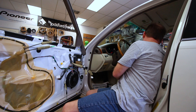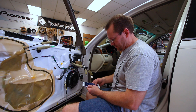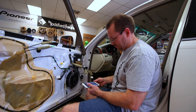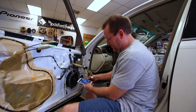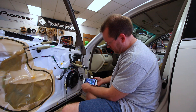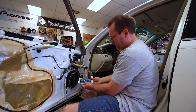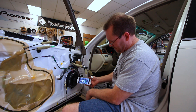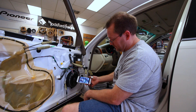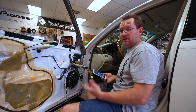Now we'll switch over to the radio's auxiliary and use the Speaker Pop app. We unlock the phone and turn it on. We hear it making sound. We turn it down some to reduce the output so we don't damage the speakers. And there we go — it's showing us that we've got it right, which we already knew. Now we can take this around to each speaker in the car and make sure they're all in phase and everything sounds amazing.